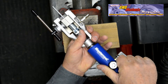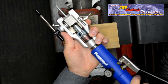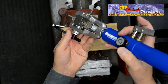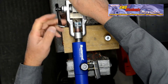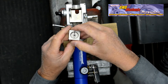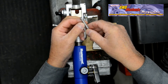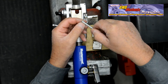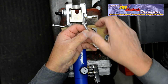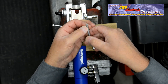When reasonable resistance is met, loosen the valve, back the Hydroflare handle off, remove the adapter, and note the shape of the bubble flare. This is a bubble flare with a flat back and slight radius, which is ideal at the backside of the flare. This prevents a sharp break that would otherwise put the tube flare at risk, and the flare is now fully formed. The tube is ready for installation.